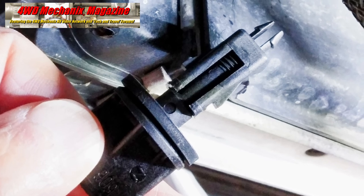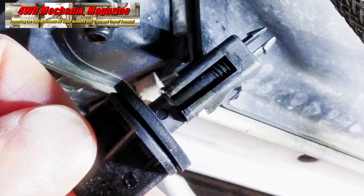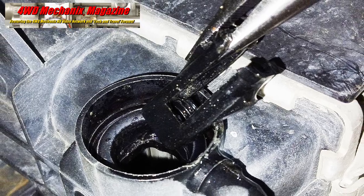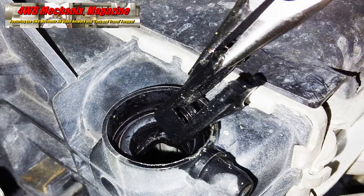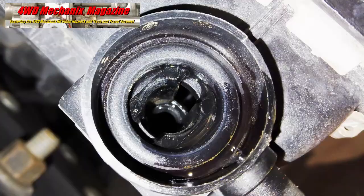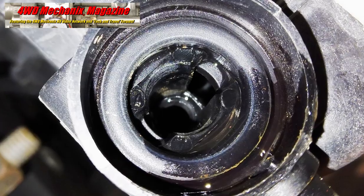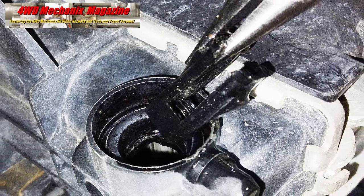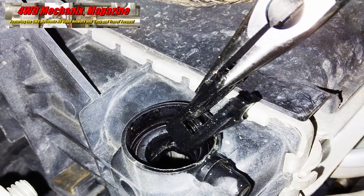Mopar used this petcock briefly. It is apparent why. The new kit comes with the plastic stem and plastic threaded seat. The easiest method for removing the old seat is a needle nose pliers. Slide the pliers deeply enough to capture one lock tab, then bend that flange inward. Tilt the piece to release the other tab. Use care not to scratch the ring seat where the rubber gasket seats and seals. Fortunately, despite this marginal design, the item is serviceable. $6.79 at NAPA is a lot cheaper than replacing the whole radiator.